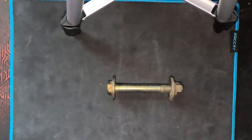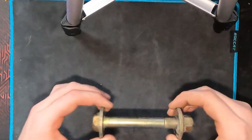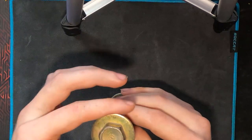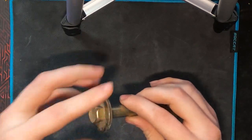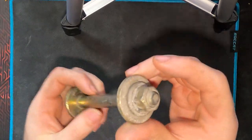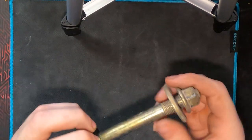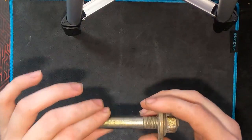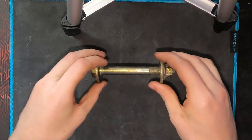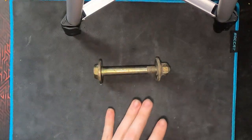So from the factory, the bolts that come on your lower control arms look just like this. They have a round washer, which is part of the bolt, and then a free washer, and then a nut. This connects your lower control arms to the frame — they mount at the pivot point of your lower control arms.